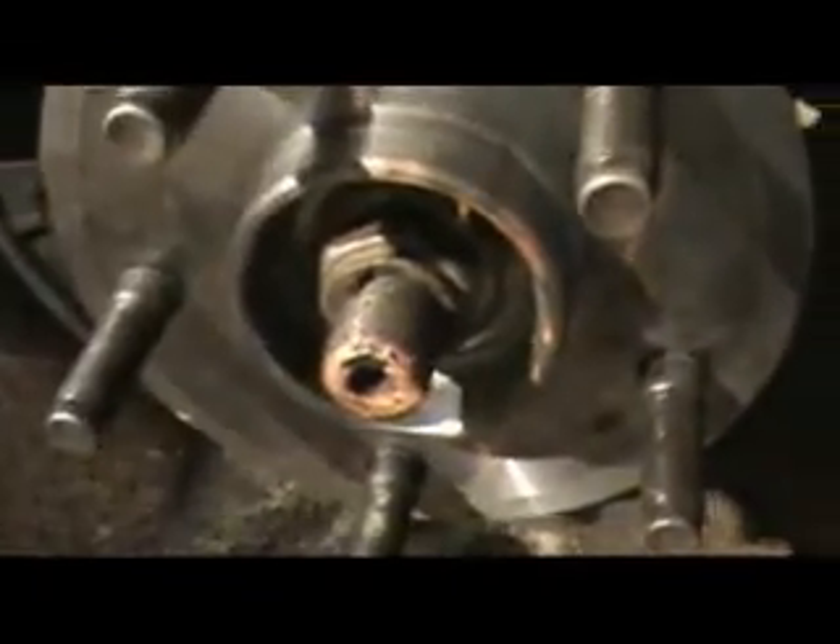Don't forget, when you're doing this, make sure you put plenty of anti-seize all around. This is the old bearing — it's aluminum to steel. This is steel, but when it goes in the aluminum you can see how it bonds. That's just aluminum flakes coming right off of there. So you want to make sure you give it a really good dosing of anti-seize. It'll save you a lot of problems if you ever need to take it apart again, and if you're planning to have it on the truck for a while, you will be taking it apart again.